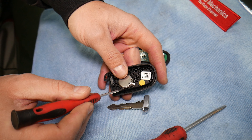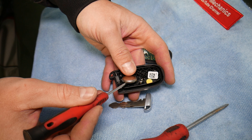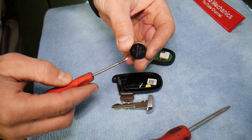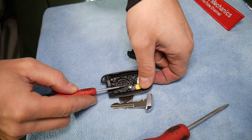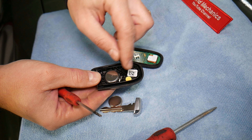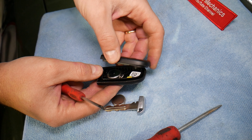Get the battery and gently pull it out with the screwdriver on this side — it comes out. Then get the replacement battery. It goes in with the positive side — the plus sign — facing down. You can see the plus sign right on it. Install it in this corner first, push down, and make sure you don't bend the connection right there.